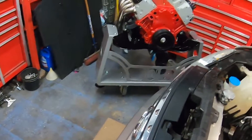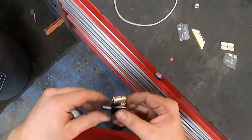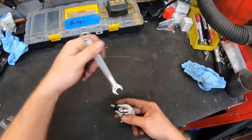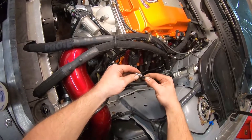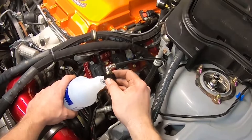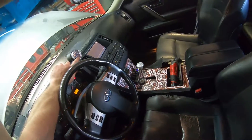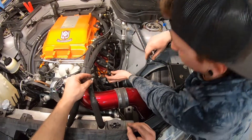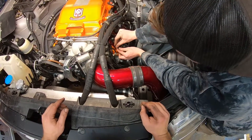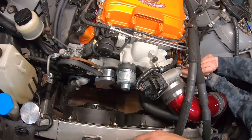To leak check the system, I took one of the smaller nozzles that came in the base kit, put it in one of the nozzle holders that didn't work with the injection plate, made a makeshift nozzle setup with a push-to-connect fitting, and put it right on the end of the hose in the engine bay. By putting a nozzle on there it puts back pressure on the whole system, allowing us to check all fittings between that nozzle and the back of the engine bay for leaks. We purged it a couple of times — the spray pattern looked great and flow was good. Once done, it was just a matter of installing cushion clamps and zip ties to hold the hoses away from heat sources and vibration, then standing back to look at all the work accomplished in one day.